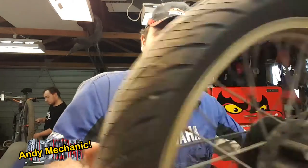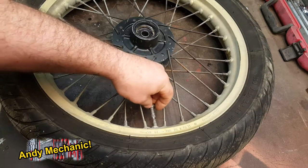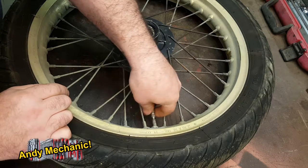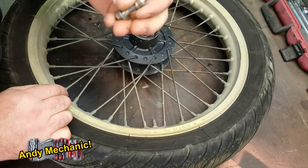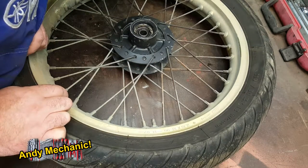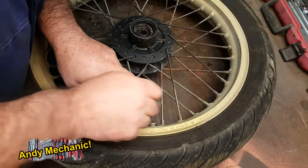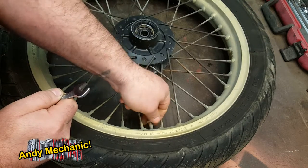And the first job is to take off the tire. Right. Well, to get the tire off, we've got to first of all deflate the tube. To do that, we take the core out of the valve. Ooh, I think that's got a bit damaged. Right, oh well. I think your valve's squashed, Ben, on your tube. No. You've killed it. Okay, and then we undo this lock nut here, look. Get rid of that. Well, that still threads off, alright? Cool.